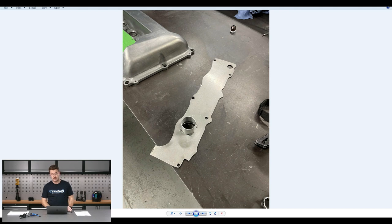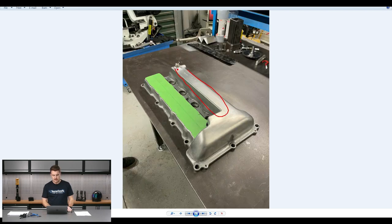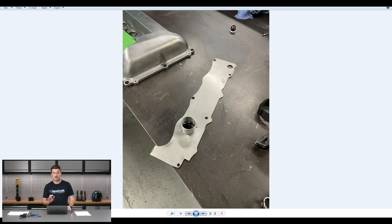While I was there I took a picture of the little baffle plate he's made as well. This baffle plate mounts in the other side of the rocker cover. You can see there's a dash-8 outlet there, and we're going to fit a second outlet which runs to our dry sump tank in the back. Before the oil can get out, we run it through this little baffle to make sure that oil being flung around by the cams hits the baffle plate and takes a labyrinth path to get to the oil tank. The idea is to keep oil in the engine but allow any blow-by gas to bypass back to the tank without pumping a lot of oil to the back of the car.